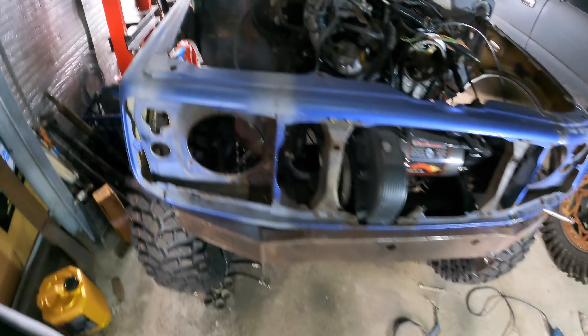I don't know what kind of bar work I'll run yet — it will have a roll cage. I'm working out what I need: if I only need a four-point because it's a ute, but it's a soft top and soft tops usually want six points, so there's a bit of confusion there. I've got a heap of body work and bar work to do. Once the shocks are done, I'll strip the car back down to a bare chassis and weld all the brackets properly, flip the chassis over, clean all the paint off, re-spray the chassis and all the brackets. I'll shave the rear diff and brace it while it's all apart, then build the car from the diffs up — put it all back together for the last time.